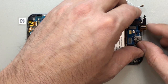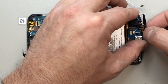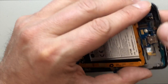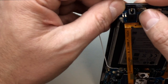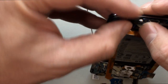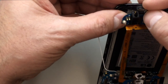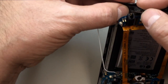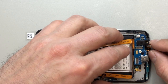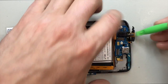It's a little hard to explain — it's much easier to watch a video showing how it's done. These things have one particular way they can be installed, otherwise it just doesn't come together properly. There's also a rubber cover that goes over the microphone at the bottom — that little gold square. If it falls off, make sure when you put that rubber piece back on that the hole in the side of it is facing towards the bottom of the phone, as that actually allows the sound to enter the microphone. If you put it on in the wrong position nobody will be able to hear you talking when you make a call.